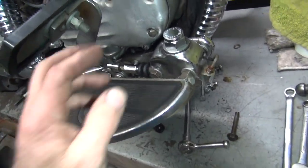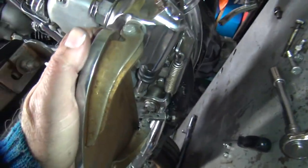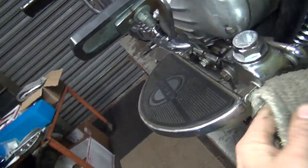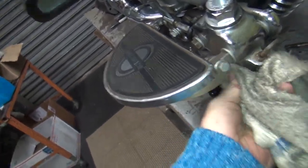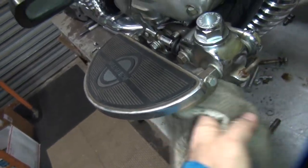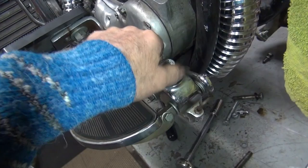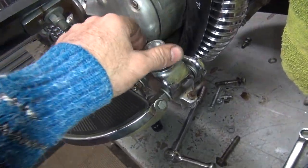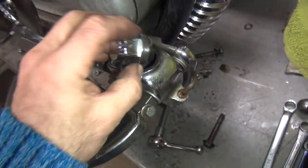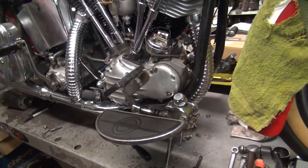Now we've got to get all this stuff cleaned up. We've got to put some brake fluid in here and we've got to start bleeding the line. We also need to adjust the rear brake and check it. We've got to wipe off everything up in here and make sure there's no fluid so that we know if there's a leak — because right now it's dry. The cylinder's kind of dry so I can get some brake fluid too. And answer the phone. We'll be back in a little bit.